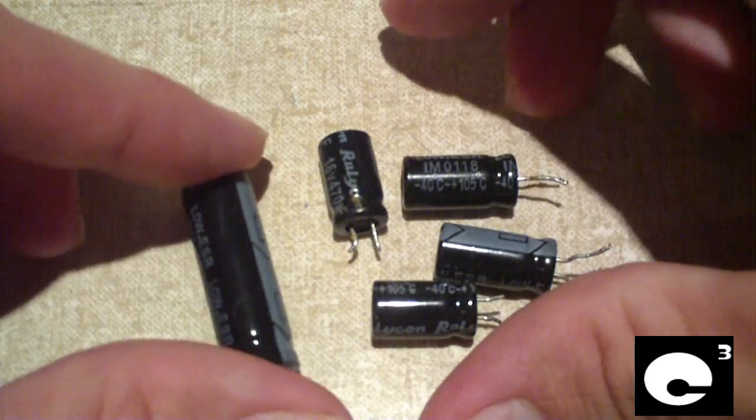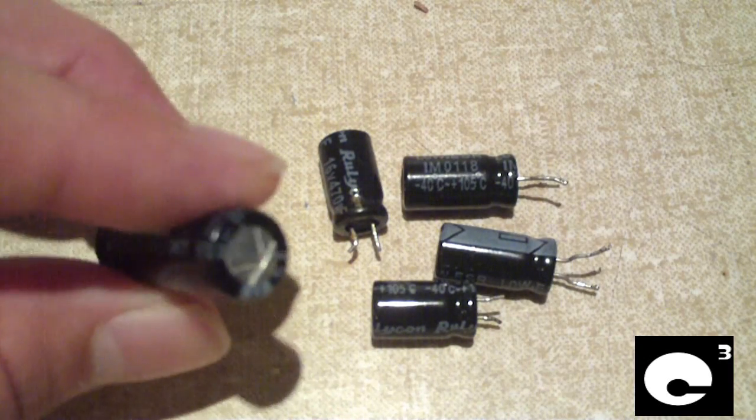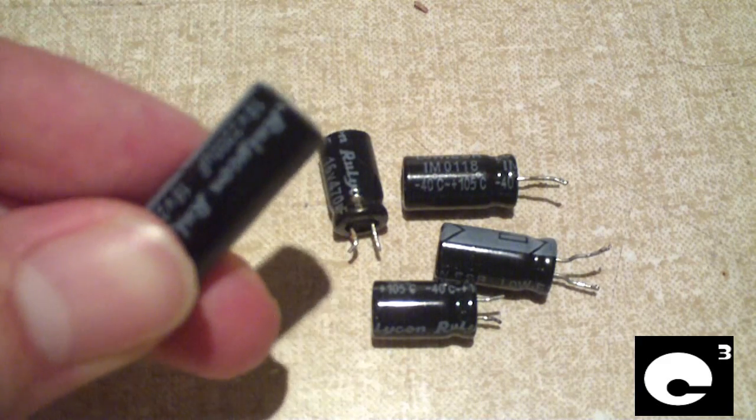Notice the bulging top. You may have seen that video I put up recently about that Allied power supply failing after just eight to ten hours of use. The power supply got used for that amount of time and sat in the computer system for a few months. I pulled out five Rubicon capacitors, and this one here was the culprit because it has a bulged top.